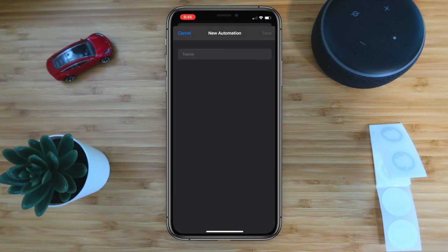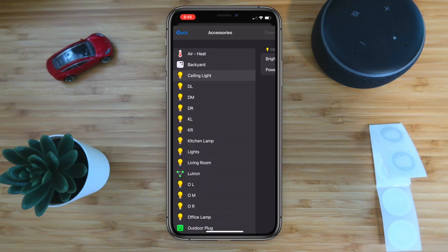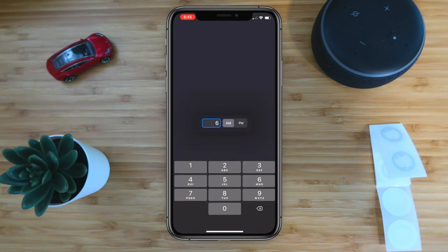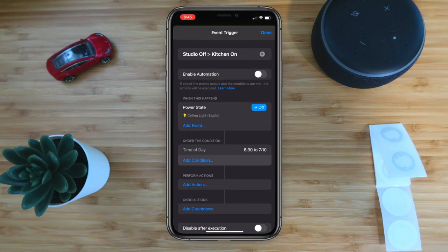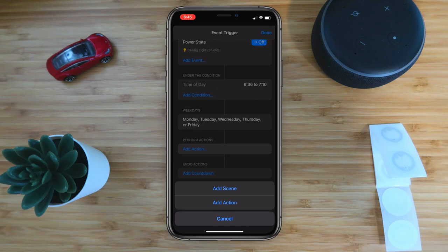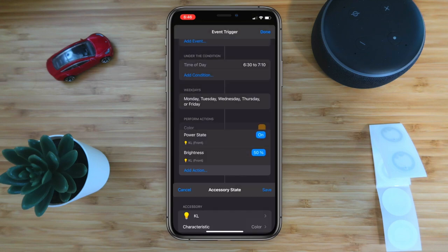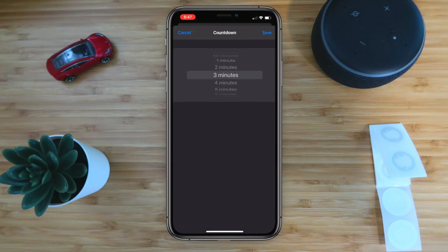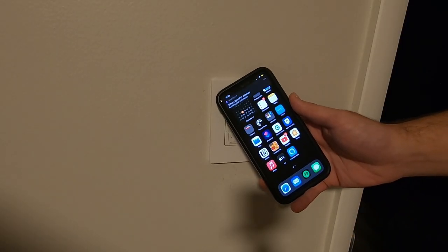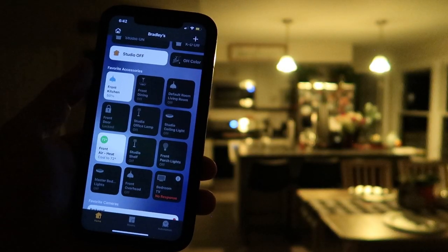Open the Home Plus 4 app, tap the Automation tab, tap the plus sign, choose Create Event Trigger, and give this event a name, then tap Save. Under 'When This Happens,' choose Add Event, tap Accessory State, choose your light — in my case my ceiling light — tap Power State, then Off, and tap Save. Under the condition, choose Time of Day, set your beginning and ending times, tap Save, then go back and add the days you want — for me that's Monday through Friday. Under Perform Actions, tap Add Action or Scene, choose your accessory, then set your power state, brightness, and color for your lights. Under the Undo Actions tab, tap Add Countdown and choose how long to wait before turning off — in my case, three minutes. Tap Save. Now when my ceiling light turns off with an NFC tag between 6:30 AM and 7:10 AM Monday through Friday, my kitchen lights turn on to 50% at a warm color and automatically turn off after three minutes.